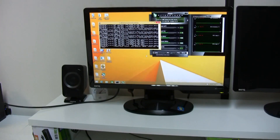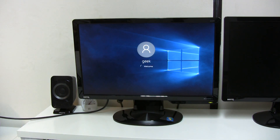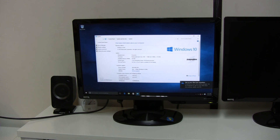Let's have a look at the actual display - I might have to change the modes on it. Okay, it's already straight into Windows 10, that was included with it. Let's do Windows pause and break and have a look at the processor. It's a Pentium Dual Core E5400 running at 2.7 gigahertz with 3 gigs of RAM. The Windows 10 installation is actually 32-bit - I was hoping for 64. I'll need to reinstall a 64-bit version since ethminer and all those applications are 64-bit.